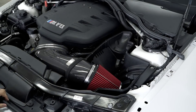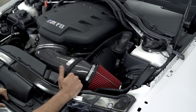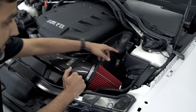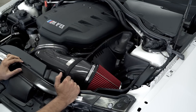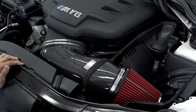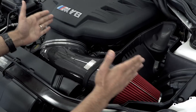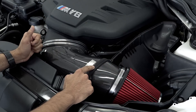With the intake installed, you can see the airbox with the lid removed — it's such a good design, a big volume, and there's not much more volume you can get out of this engine bay. It's sealed via this water drain. We didn't redesign the airbox — there's absolutely no need — so we've just focused on the tube. The cone filter we used is the biggest we could fit in the given space, with a double cone for maximum surface area. The neoprene-covered portion is where the airbox lid sits, so as the engine moves the tube can move without breaking the seal, because neoprene is a sponge so it compresses.